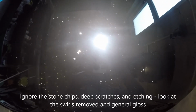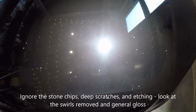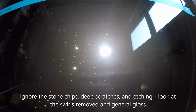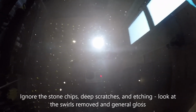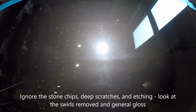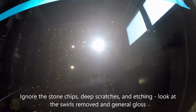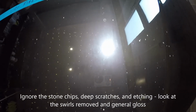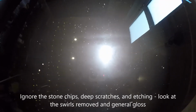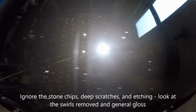Now, I've used a Uro Fiber pad on medium and hard lacquer, and I will say that on medium and hard lacquer, this combination of the Uro Fiber pad and the Sonax Perfect Finish actually finishes down like this. It finishes down really well. However, on soft lacquer, you can see that the slightly more aggressive nature of the microfiber, even though it has a 50-50 blend of cutting and polishing fibers, has actually caused hazing on soft lacquer, which this panel is, and you can see the difference.